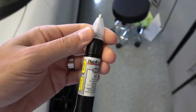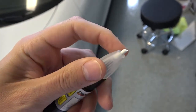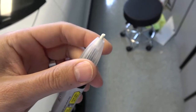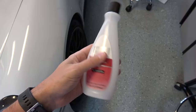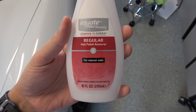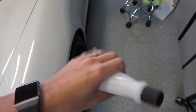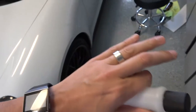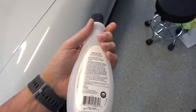One thing that really helped me was this Duplicolor touch-up pen — these pens have a little sander at the top, shaped like a pen. It was really useful for sanding down the edges of the chip, because you don't want sharp edges; those remain very visible when you do a touch-up. The best way to get the paint flat is to apply it, let it dry for a few minutes, then use nail polish remover on a rag and brush it over your paint glob — it smooths it out. When you're done, get a rag with water to remove all that nail polish remover.